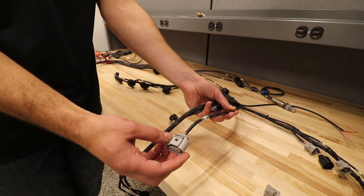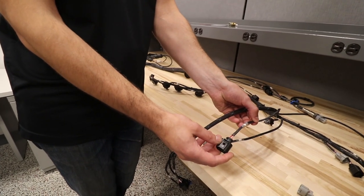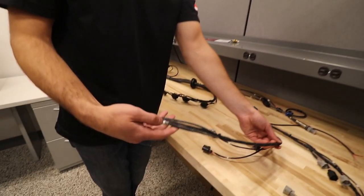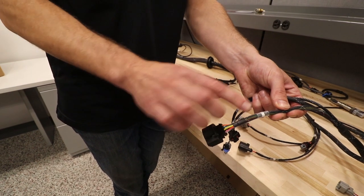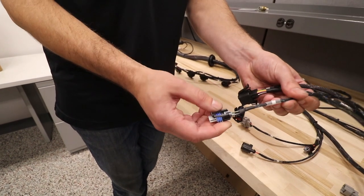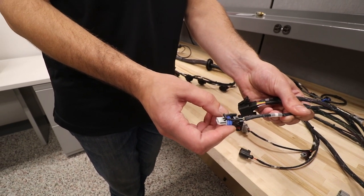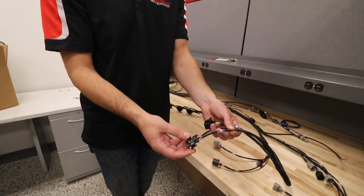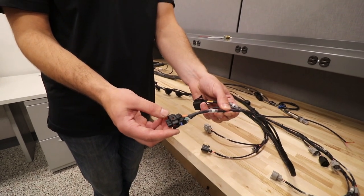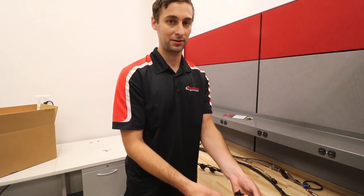The other branch goes under the intake manifold and includes your oil pressure sensor — like the fuel pressure sensor, it's a 0–5V input to the ECU for logging and protection strategies — your crank position sensor which routes nearly to the bottom of the vehicle, and two wires for your alternator. The final and longest leg goes to the throttle body, including the throttle body connector labeled TB, the intake air temp sensor with a standard GM connector that plugs directly into the included IAT sensor, and the MAP sensor connector which goes directly to the included MAP sensor. Two MAP sensors are provided: one for naturally aspirated and one for forced induction applications.